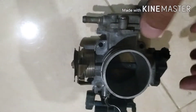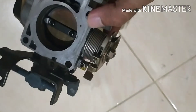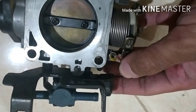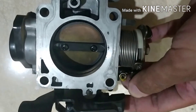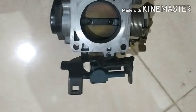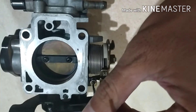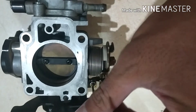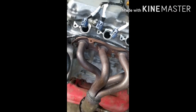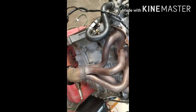The throttle body needs a throttle position sensor and I don't need an idle air valve control. This is a very very basic engine — on my Honda L-series engine I don't need many sensors, only the basic sensors. This screw is adjustable because you don't need an idle air valve control. Use an allen key for the screw adjustment. Please don't open the valve too much because the air will be forced into your engine and make the mixture very lean.